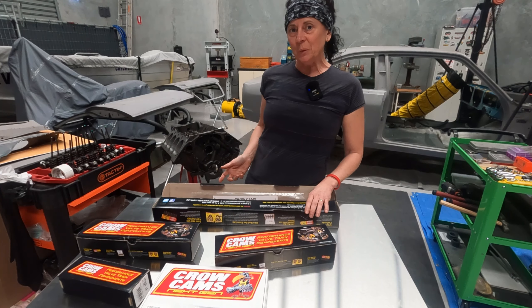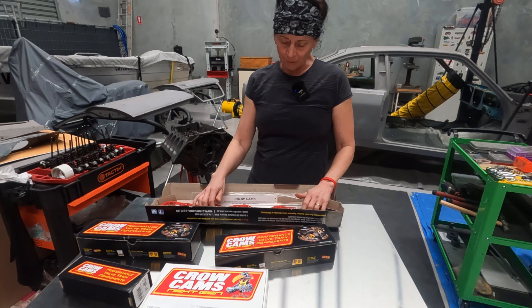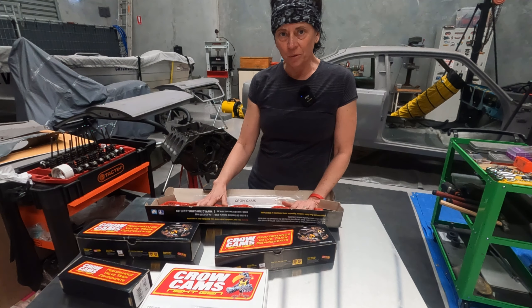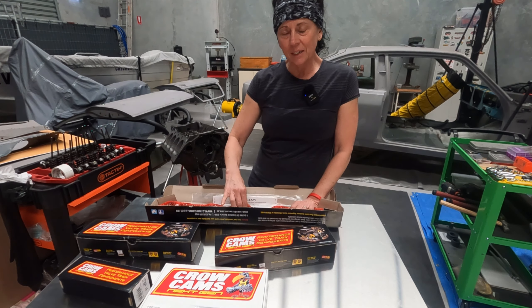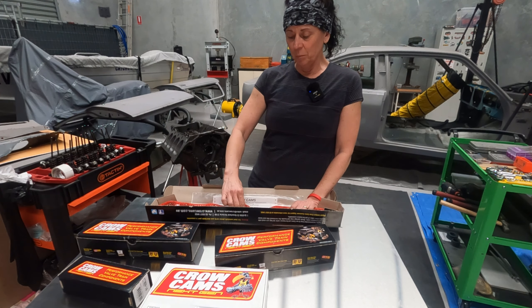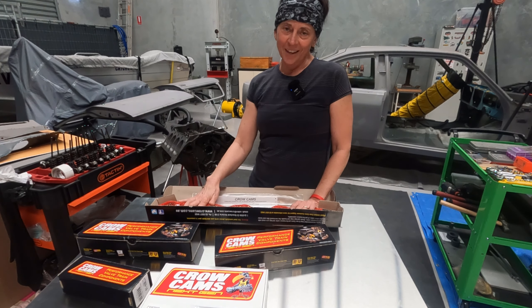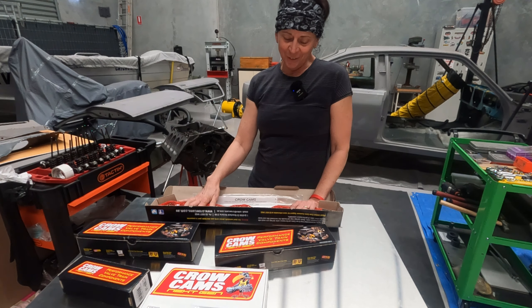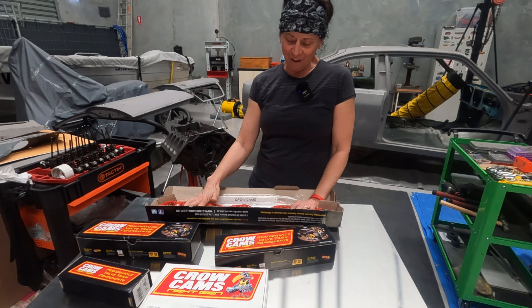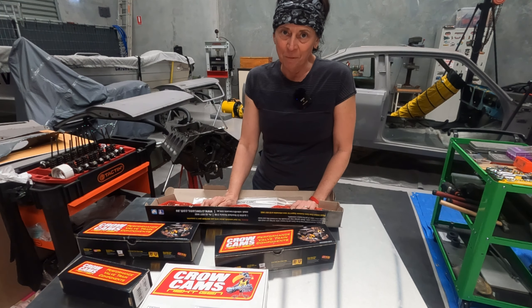Now because of that, I'm not building this engine for high performance — I reckon it is lucky to get a second lease on life. So the cam that I chose is for a bit of fun really. It's designed for a fairly streetable RPM range of about 2700 to 5800 RPM. It should be a pretty lumpy idle, and I kind of want that. I like that sort of beast-like quality that a V8 can have. So really I have chosen this cam more for entertainment than for performance.